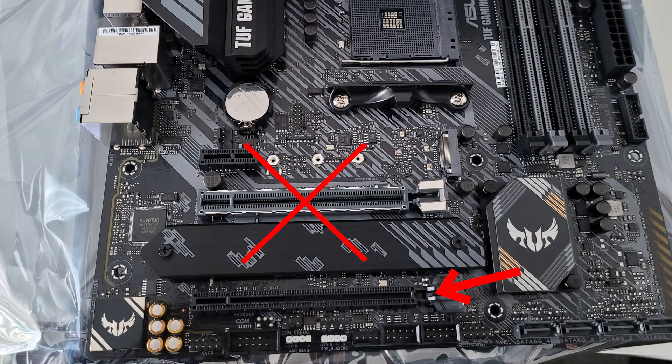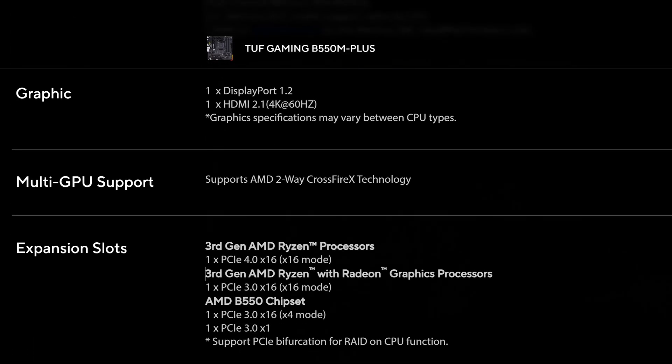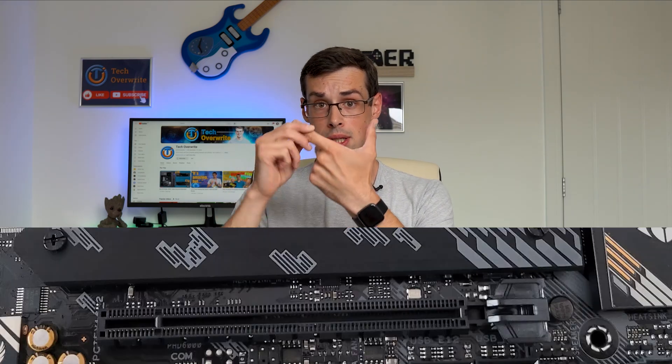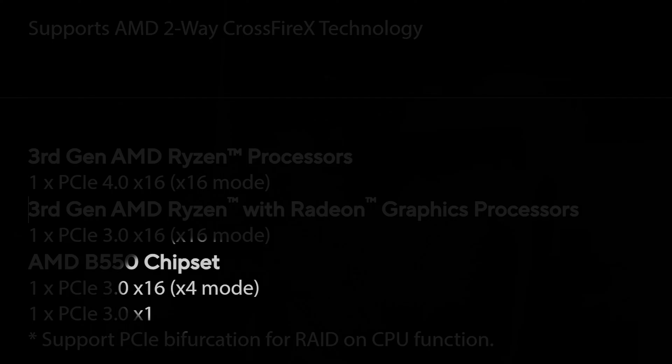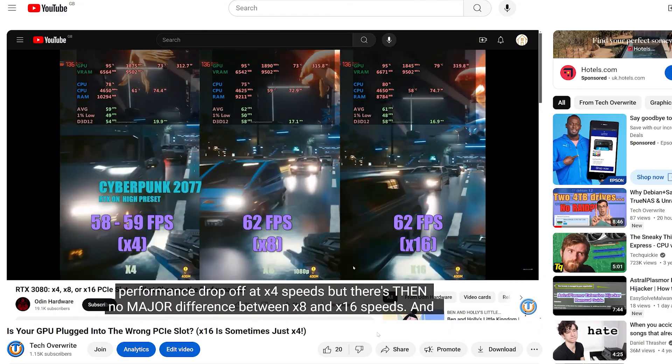The final thing you could try is to put your graphics card into a different slot, other than the top one on your motherboard. This would free up room so your other PCIe card could go into that top slot. However, there can be big downsides — often the top PCIe slot runs the full x16 bandwidth using your CPU's PCIe lanes, while many other slots run at lower bandwidth. Even if they look like a full x16 slot, they might be cut down to x4 or x8 speeds under the hood, which could reduce your gaming or rendering performance. I discuss this more in another video, because sometimes your FPS won't be massively affected by putting your GPU in a different slot, but other times it definitely will.